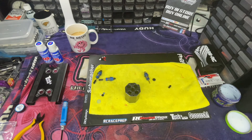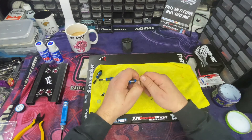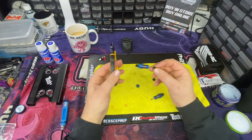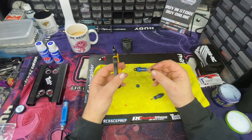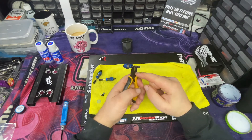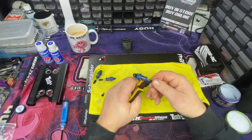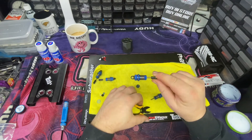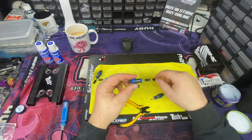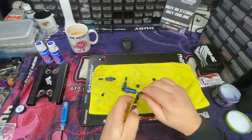We've set the minimal amount of rebound I can get with these diaphragms. Now I'll show you again — laying the diaphragm from the back to the front, minimising any air that gets underneath. Push the shock shaft in until the threads are just before the guide. Take the driver and in gentle circles just work that excess oil out, get that seated. I like to leave a tiny bit of the thread exposed at the bottom of the shock so I can take the bottoms off.